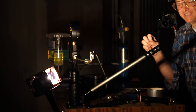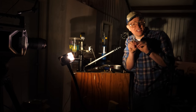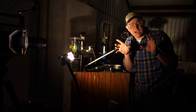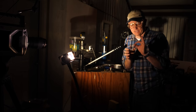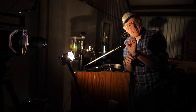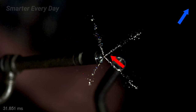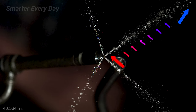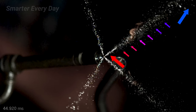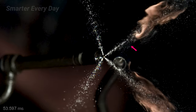Okay, I'm starting to understand this. I can't see the camera, there's so much light. The stoichiometry is changing radially out from the center of the injector. So think about it. Boundary conditions: right at the little exit, it's 100% fuel. Way out into infinity, it's 100% air. Somewhere in between, there's a gradient, and so there's an optimum mixture point somewhere between the nozzle exit and getting out into the air.